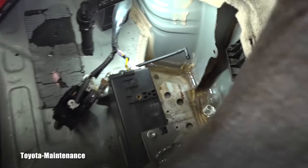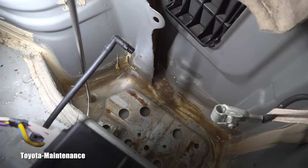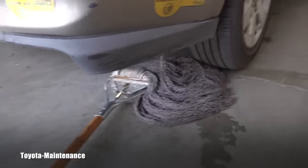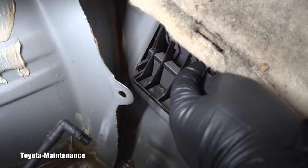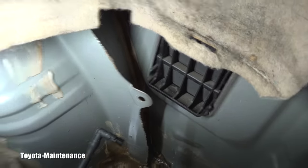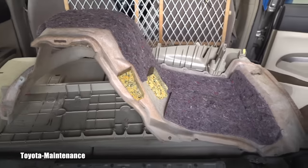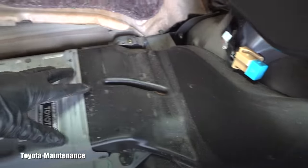I've got a mop ready because the bucket won't fit — let's drain the swamp. Look at all that water coming out. Now that gives us a really good view of the vent. This is where the hybrid battery air is brought out through that pipe we saw in the beginning. All of this needs to be functional to move hot air away from the hybrid battery.